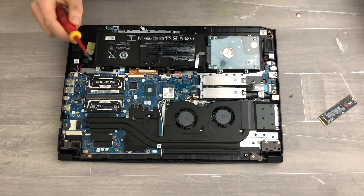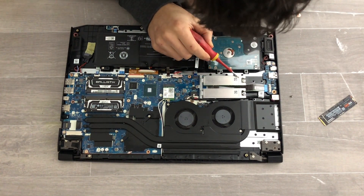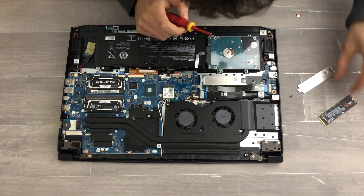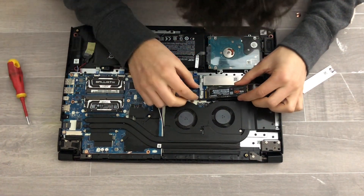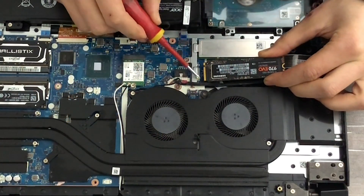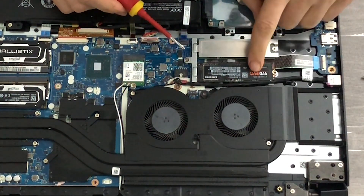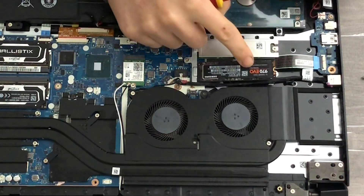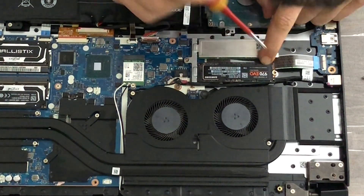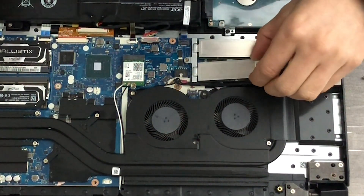Once you've got the main cover off, you then want to take this inner cover off. You can see under it there is the original SSD that came with the laptop. All you do is take this little screw out — which I've already done — and then that just pulls straight out. Then you get your new SSD and these go in at a bit of an angle. Make sure you've got the larger strip and smaller strip the right way around, and it just pushes in nice and snug. It sits on its own — it's springing like that because the connections are pushing against each other, which is good. When it sits here, that circle sits perfectly around where it screws in, so you know it's pushed in far enough.